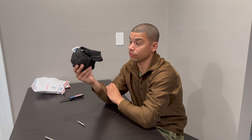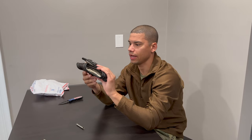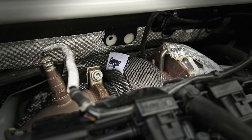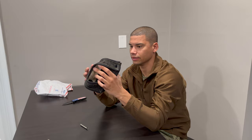Okay, we're back at it again. You guys just saw in the in-car video — I screamed about the EPC light. We really sent it today. I really didn't get to run this for very long, but this is for the IS38. It's by Forge, it's the cheapest one on the market — like 60 bucks new, and I got it for like 50 bucks. Shout out to Patrick, my boy. So we're going to toss this one on today. One of the main advantages of insulation like this on that turbo is that the O2 sensor isn't on the turbo anymore, it's on the downpipe. If you've ever installed one of these on an IS38, you know that O2 sensor being in the way is really a pain. So as soon as this rain calms down, we're going to head outside and see how this fits.